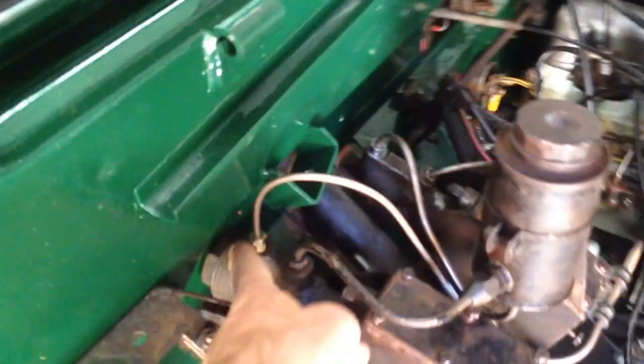With the brake, it comes around. I've held it in place by these two clips here. Then it joins, goes all the way and then joins to the junction here. It comes up, down around here and joins in this little bracket here — you can probably just see it right there. And then heads down towards the clutch via the flexible hose.